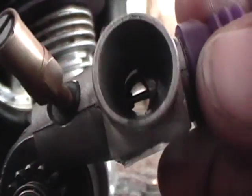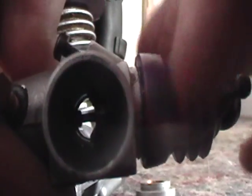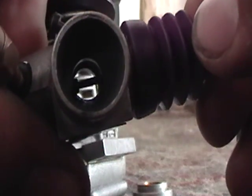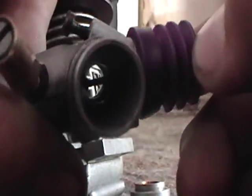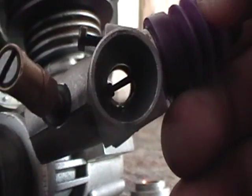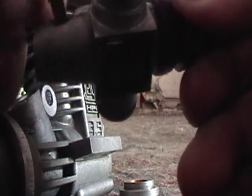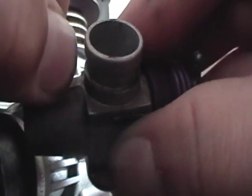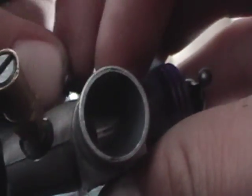Right now I have the idle mixture all the way in. Once you get right around here, the pin slides out of that hole. The motor runs a little bit richer when that happens so that it can run good at high RPMs. And at low RPMs, because it's a slide carburetor, it's closed on the other side too, and basically that'll act like a choke at low throttle, so that'll just suck too much fuel in and not enough air — it's like running it with a choke on.